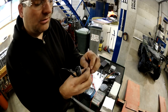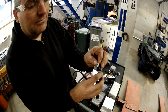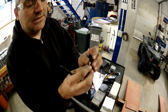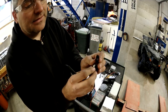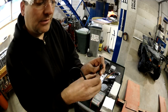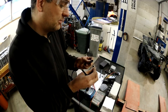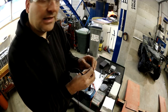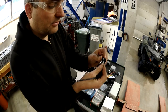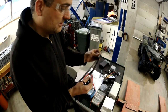And then this small hatch, or this contact plate that is inside, it will flip together with this thing that pushes this contact plate, and they are misaligned, and then the switch stays on in either directions. It's even possible to burn the winch motor, I guess. But there's nothing you can do in the forest when this happens. So this is really poor in design, this switch. And this is 90 euros. So it's a robbery.